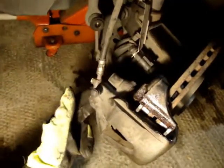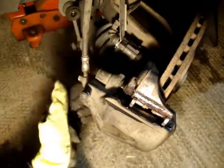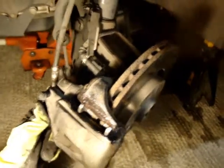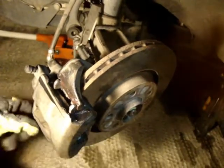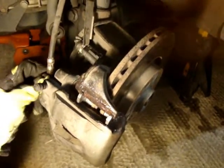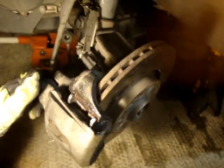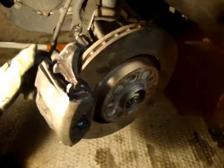I got those bolts back in — they're all tight — and I put the rubber caps back over top of the bolts to keep the weather out. Next thing you're going to want to do is go in the car and pump the brakes; that's going to push the pistons up against the brake pads and get them all snug. After you've got that done, go up to the reservoir and check the brake fluid. If it's low, that would be a good time to add some. If it's above the high mark, take some out. If it's good, just put the cap back on.